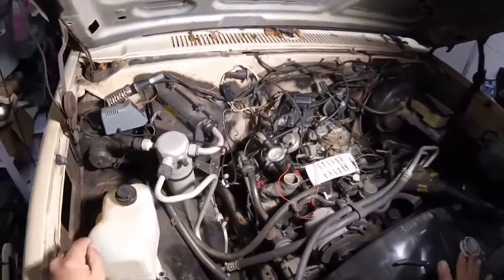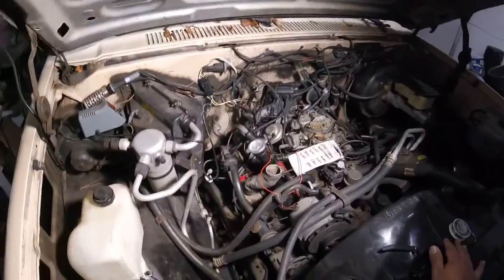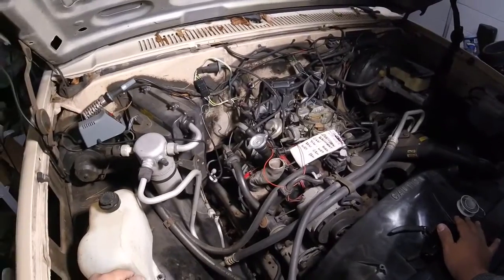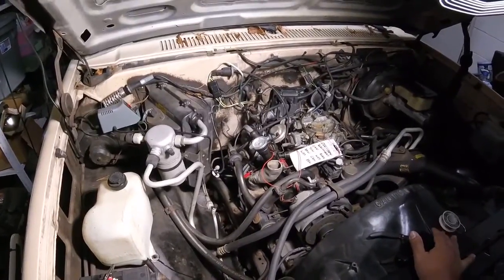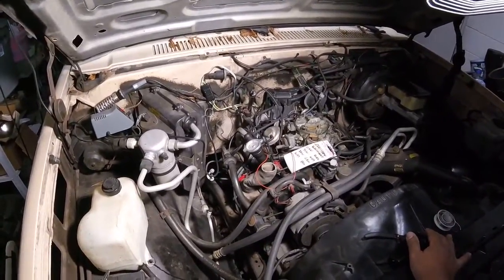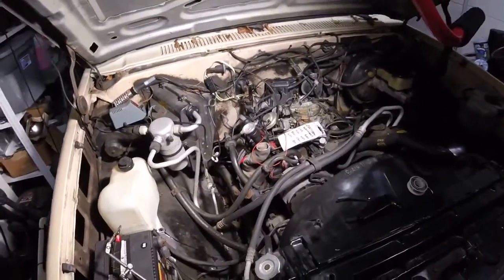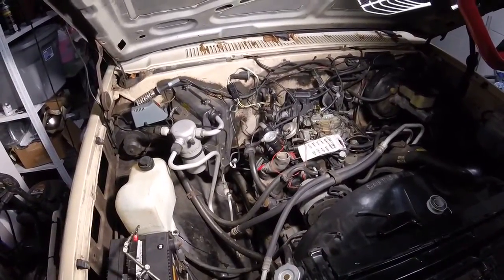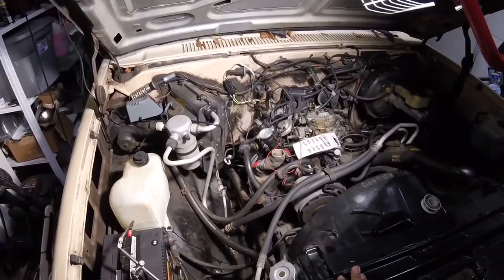That way it doesn't give insufficient spark — it's just not a great system to have. Sometimes it's intermittent, sometimes it works, sometimes it doesn't — makes your car run funny. Now with this bypass, you have an HEI — high energy ignition — and basically you don't have to take out the distributor. Just jump these wires and it should be fine. I'll post some pictures of what I did; it's pretty simple. In my case it was a little difficult because I had to extend the wiring since the connector was bad.